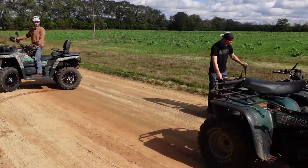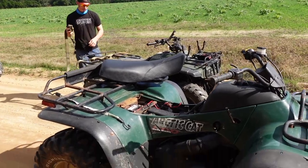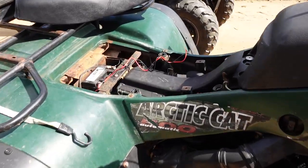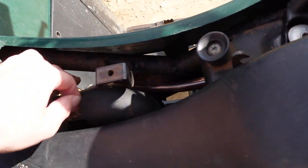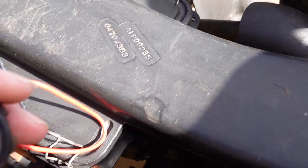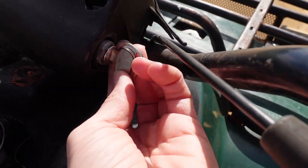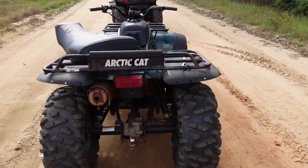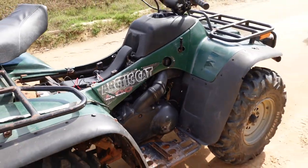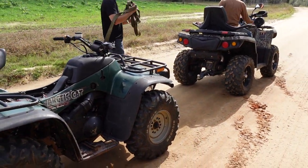We've been riding for a matter of five minutes - not even five minutes. We literally just got on the dirt road right by the house. The voltmeter is showing 13 volts, and I'm not getting the fan to come on, the neutral light's not coming on, anything. It's been on the trickle charge all last night so it had plenty of battery as you guys saw before we got on the ride. So hopefully it's just a low battery and the rectifier will fix it. We'll catch back up with you guys once we get to the house.